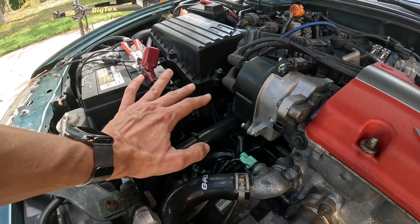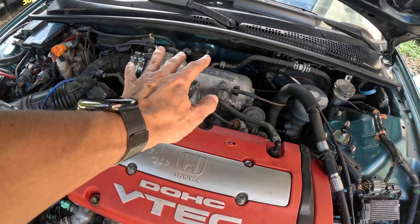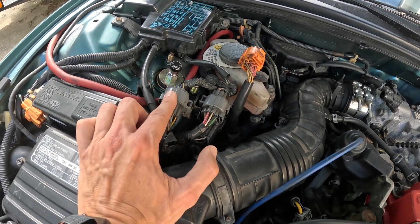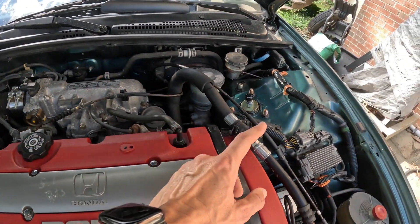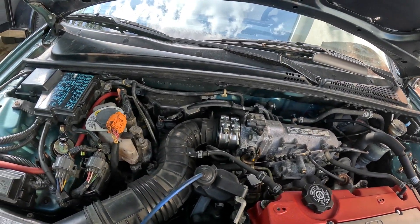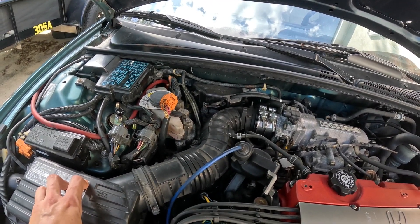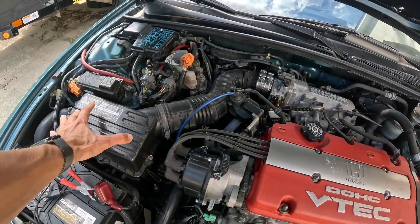Then you've got connection issues — new radiator cooling hoses, new hoses going to the heater core on the firewall. The biggest concern is electrical. On the driver's side and passenger side you have motor-side electrical connections. From what I've been reading, I need to pull these harnesses back into the cab of the vehicle. There's a tucked harness sold by Rywire I believe. I just hope I don't have to remove the dashboard, which is a lot of work. The battery is also going to be relocated since the engine will sit closer on that side, and the airbox will move over to the other side.